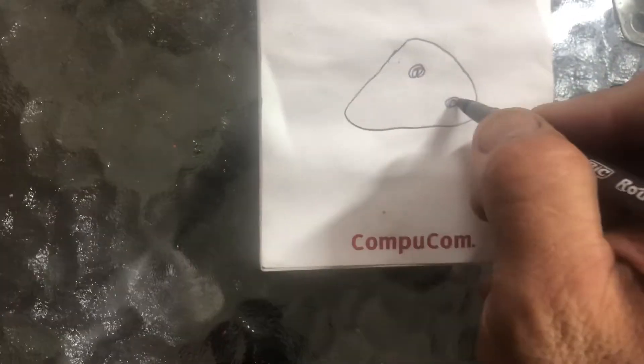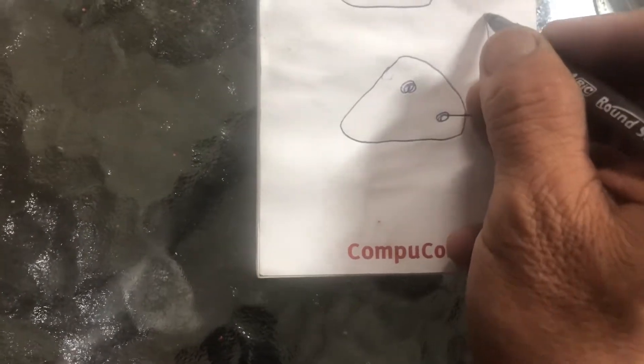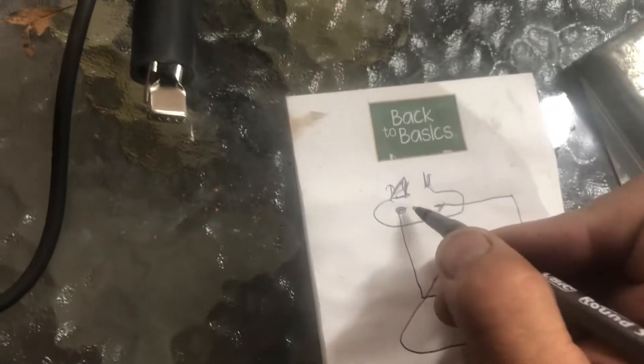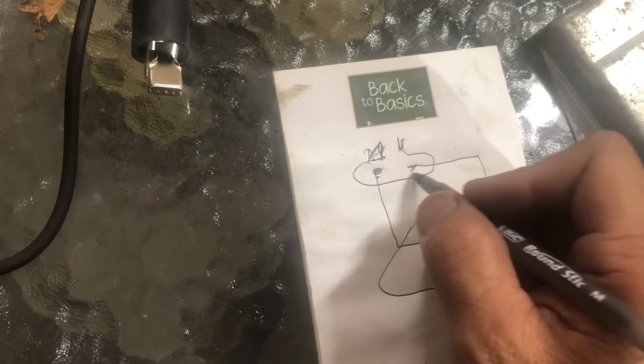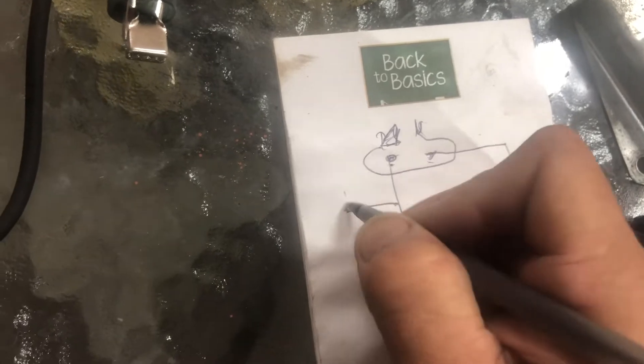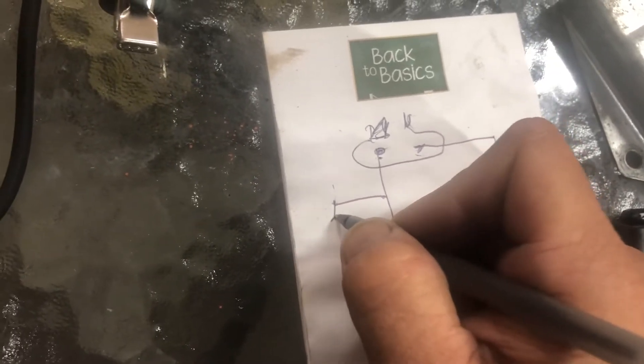Those two pins go to both your fields. So this little connector has a pin here and a pin here. This is going to go — this is normally your green wire in your Mopars — to one of the fields on the alternator. The second one, which is usually a blue wire, this middle terminal goes to the other field. It doesn't matter which one you use because they're both ends of the field, and this also goes to a fuse.